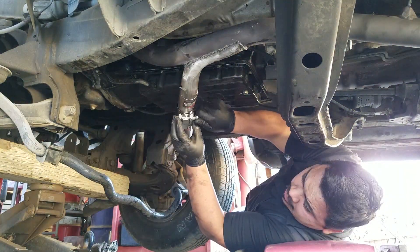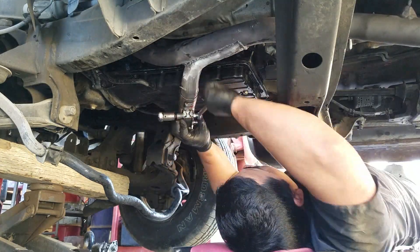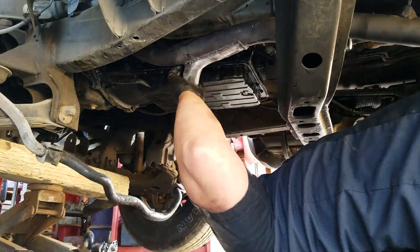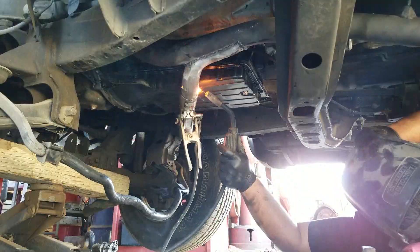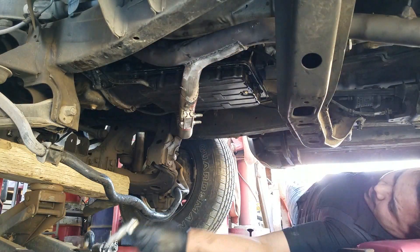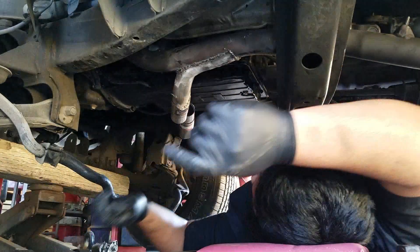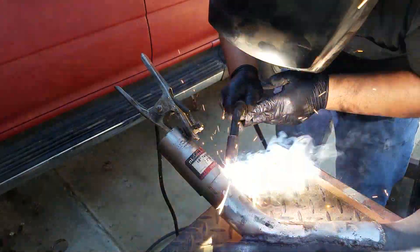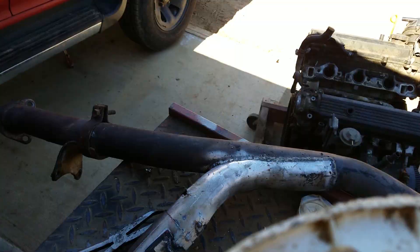You don't want to worry about lean conditions from too much O2 getting to your exhaust, you don't want to break anything, damage your electronics, or burn any wires. Make sure the O2 sensor travels around the pipe — keep it away from the pipes. I noticed after the pipe is on there, the O2 sensor needs to travel a different way so it doesn't get burned up. I moved it and zip-tied it to the frame so it wouldn't touch the exhaust, because it will melt the wires and cause more issues down the road.